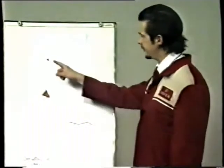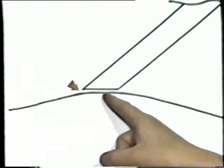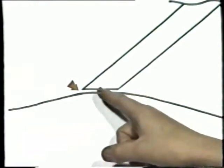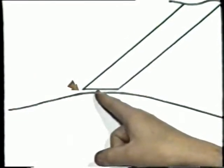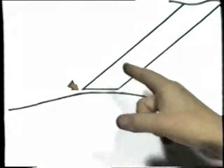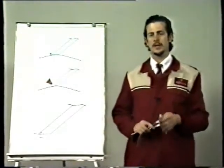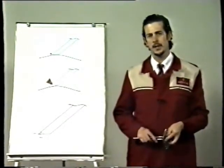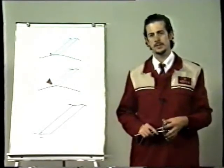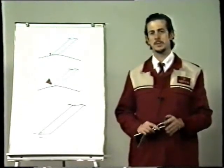What happens is, as fuel is drawn up the pickup pipe, the bottom of the tank lifts and sits against, or very close to, the bottom of the pickup pipe. This obviously restricts the amount of fuel drawn up the pickup pipe and causes the lack of power. The problem may become more noticeable when the level of fuel in the tank is low — in other words, the less the weight of fuel holding the bottom of the tank down, the more it will rise towards the bottom of the pickup pipe.